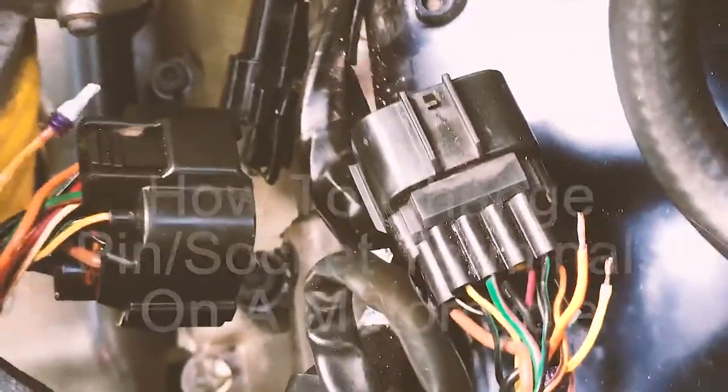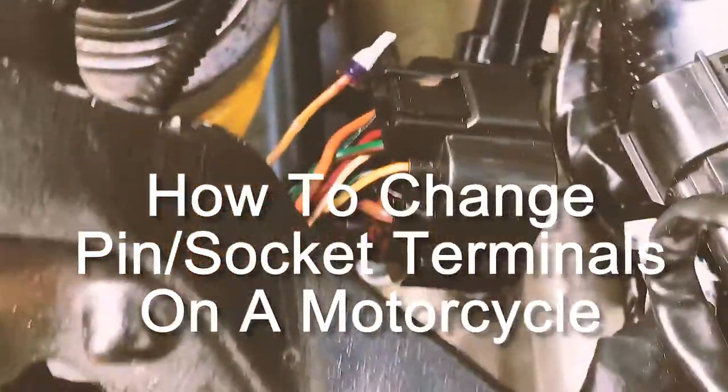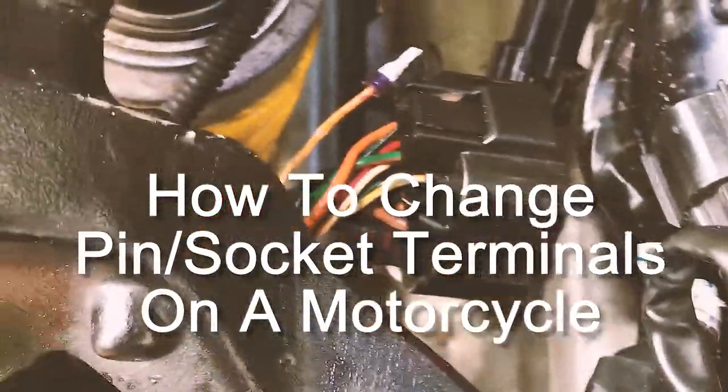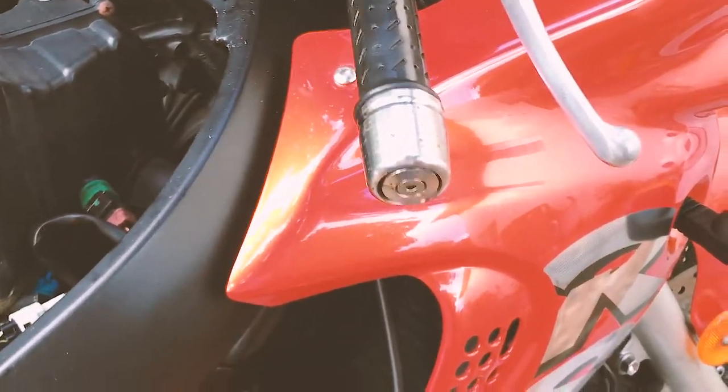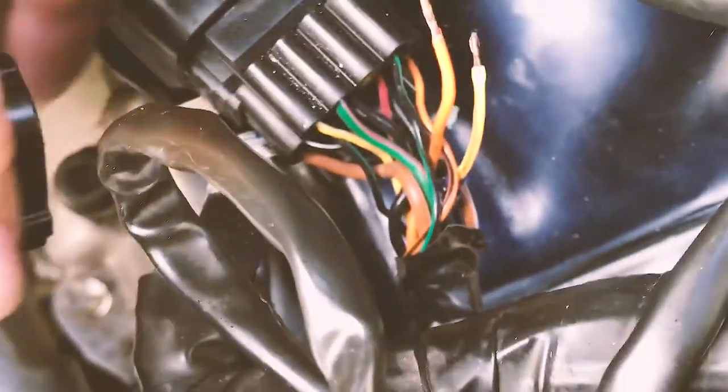Alright folks, if you have a Triumph motorcycle from around the year 2000, for example, I have the Triumph Sprint RS here from 2001, it's highly likely that when your bike is not starting, it's probably something wrong with your electric systems. And after looking for the causes, I have found that this wiring harness terminal connector is quite easily corroded